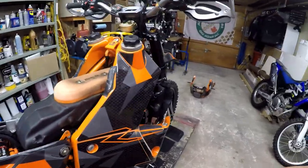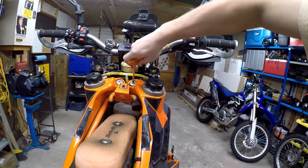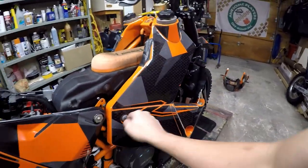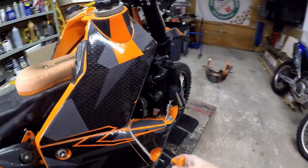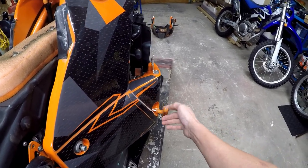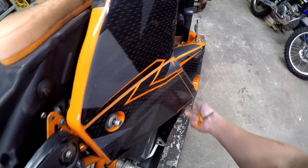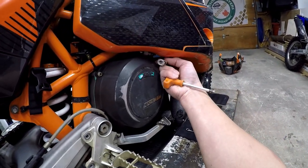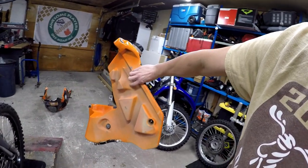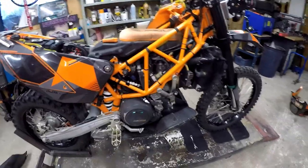To take off the front tanks I'll give you a quick demo - it's very easy. Just disconnect the hoses here - only three screws, one here and one here. There's one hose to disconnect underneath with a quick disconnect. And then off come the fuel tanks - very easy. That's it. We're down to what is basically the standard 690.